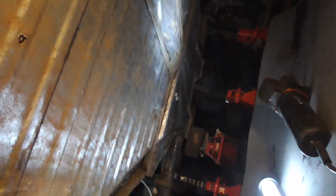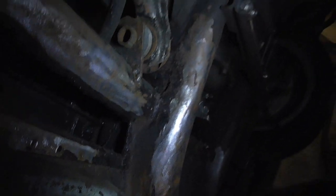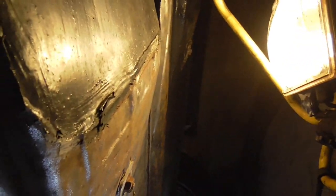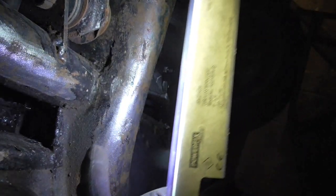I've been at this for an hour and in that time I've managed to do basically half a floor pan, and got up to the rear frame horns and had a little tickle around there. On the flat stuff it really motors — when you're on the flat pans it clears the underseal off ever so fast. It's really, really quick. It gets a little bit trickier when you get to the seams, but you can make it work — you just have to be a bit more patient with that sort of stuff.